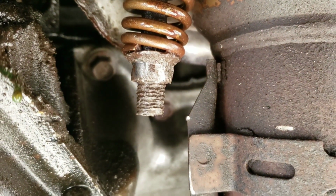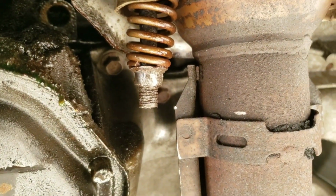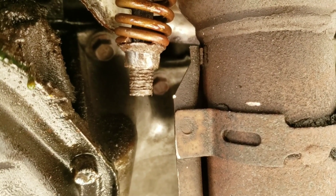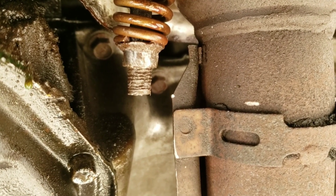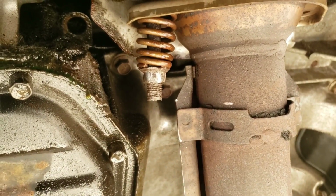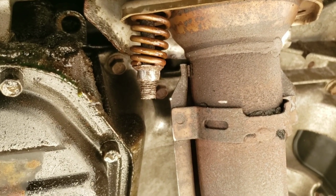I tried and I tried and eventually ended up spinning on it. So now I can actually get a slightly smaller one on there that only goes down about 1/4 of the way. So I'm going to try to hammer it on there. This sat overnight with PB Blaster on it. My impact doesn't have enough power to get it out. I need a more powerful impact.